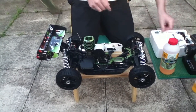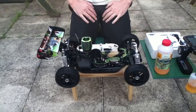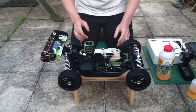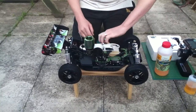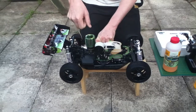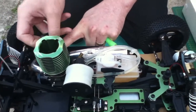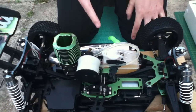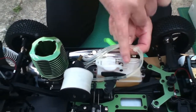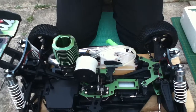I'm going to leave the controller down there for a minute. I'm not going to put any sort of throttle on it first of all. We're going to see if it starts on its own without any response from myself. Now there's two ways of getting the fuel to go into the carburettor because obviously we need to prime it first. One way is putting your finger over the exhaust and then turning the engine over — that sometimes can suck the fuel in. You can see the fuel's coming through now. Just do one or two pulls, just little ones. A lot of people also say to disconnect the pipe from the exhaust and blow through it, putting pressure into your fuel tank, which then corresponds by putting fuel down the line into your engine. I'm going to leave it primed with about a couple of strokes like I just did, and now we're going to try and start it.